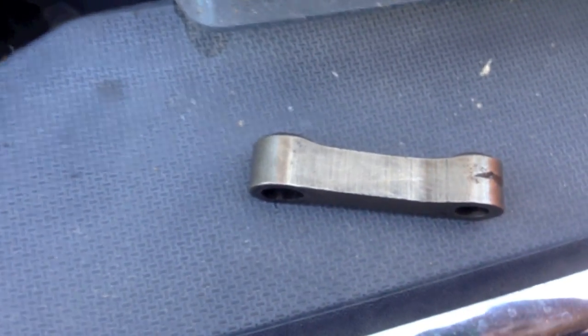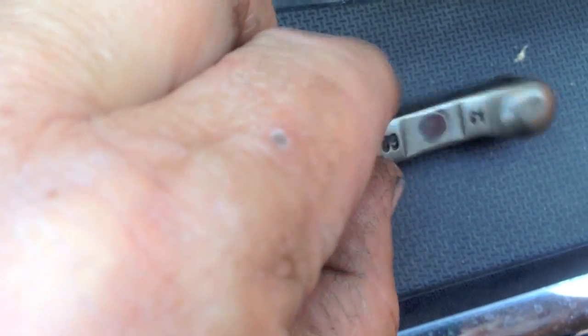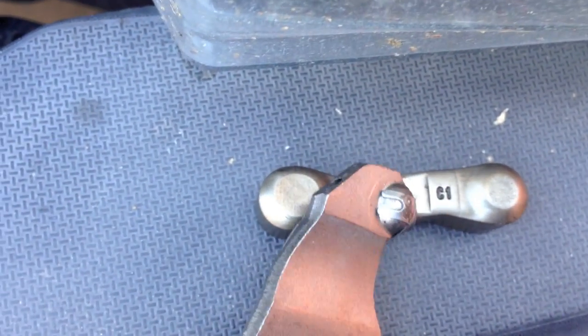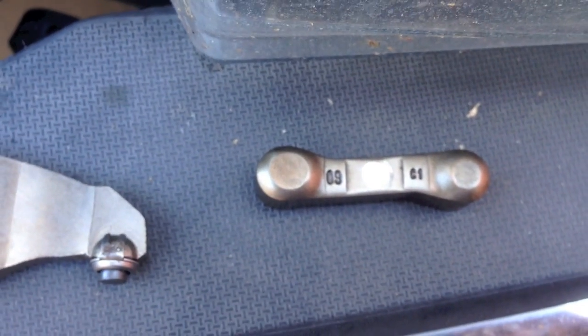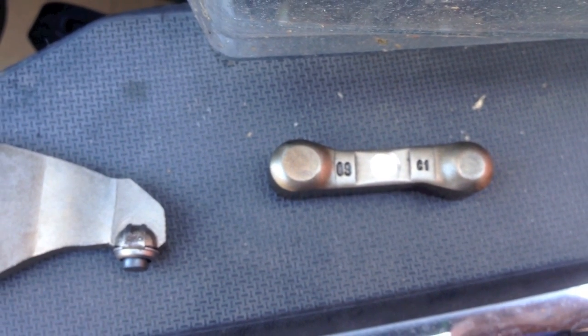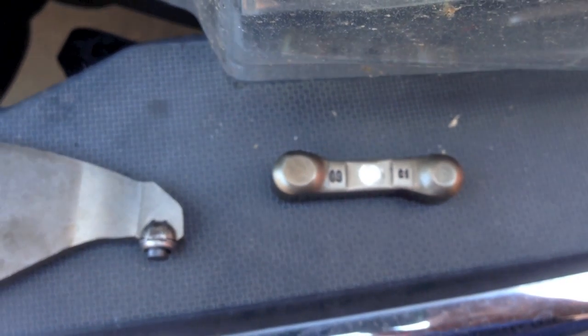But also, what I want to suggest is inspecting the bridges. These go in between the 2 valves. That's where the valve stems are, and this is where the part that's worn rides, right here in the center. That's the foot that was worn off of the other ones. So inspect these, and also you will need 8 injector reseal kits for the fuel lines, because the fuel lines have to be removed when you take the rocker arms off. So let me go ahead and start this one up and show you now that the noise is gone.